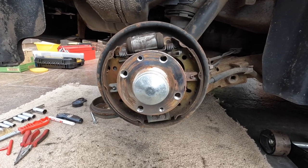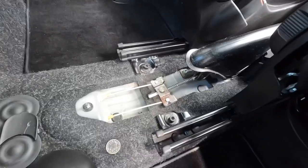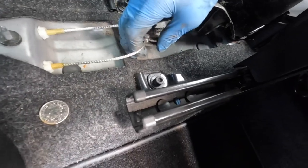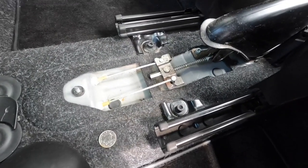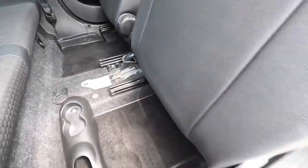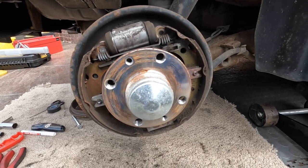What folks don't do is release the cable from the handbrake. So the rear handbrake — if you release the cable, that allows the handbrake cable to move very freely on the other side at the brake side. It allows the brake shoes to move and then you can disconnect the handbrake cable.